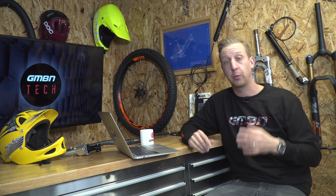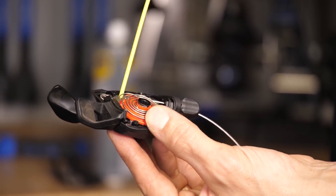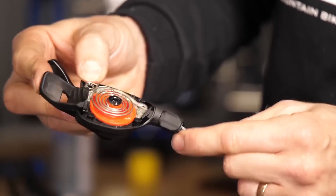Replace your inner cable when you're riding in wet conditions as often as needs be. Pay attention to the inside of your shifter as well, because when you're riding in wet conditions it's one of the parts of the bike that can trap water. I'm going to throw you to a video I did recently on where to use grease on the bike, where I actually take apart a shifter and show you exactly how to do that. When using grease inside your shifter, make sure you only use a very thin grease — I recommend a spray grease so you can put it exactly where you want without getting your hands messy.